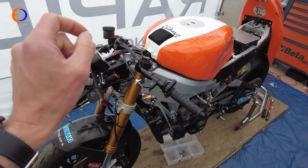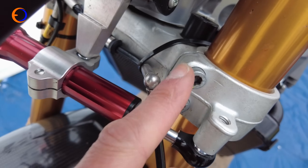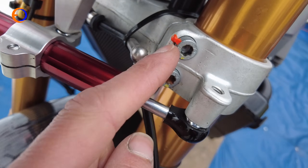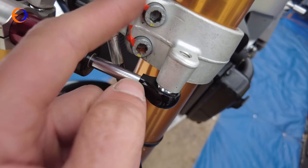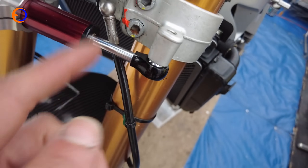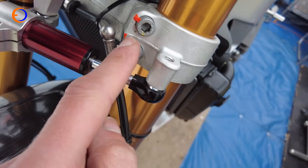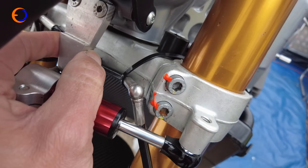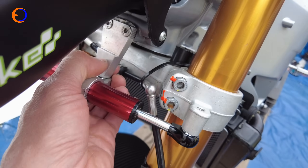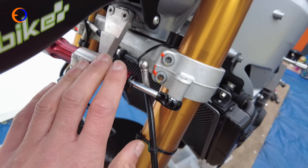With the fairing off it gives us a chance to get underneath the skin of it and have a really good look around. One of the things we're looking for is on pinch bolts — the torque check, I think it's actually called cross-check — it's like a resin, and if any of the bolts move it cracks the resin so you can see if anything's moved without re-torquing everything. We also check the steering damper brackets are tight; they're not unknown for the bolts wobbling a little bit loose on the 660s, and I like to make sure the damper itself isn't leaking.